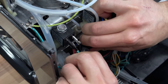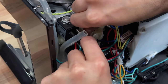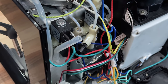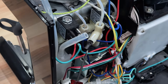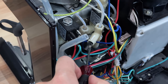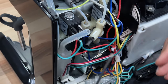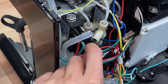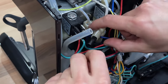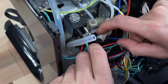Now I just want to slide this tube off, take the tube off, and take off this clip right here. Now we want to unscrew this, which is the overpressure valve. Before you do, I recommend marking it. I took a knife and scored it right here. On the other side, there's also a small marking from the factory setting — so have that marking so you know how many turns you're going to do. You can probably only unscrew this two to two and a half rotations before it falls off, so you obviously don't want it to fall off. I found two to two and a half rotations is probably the best you can do.